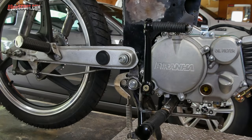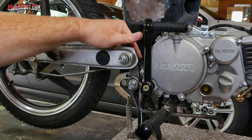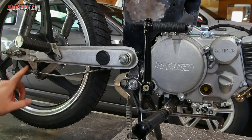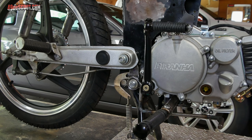It's actually starting to look like a working brake setup. I thought I was going to have to run a return spring from somewhere on the lever up to a peg up here, but it's doing pretty well on its own with just the spring that was stock on the cable, so I don't have to worry about that. I do have a few more things to take care of though. The nut on the back I still need to thread, but it looks like shipping is delayed two days instead of just the one I thought.